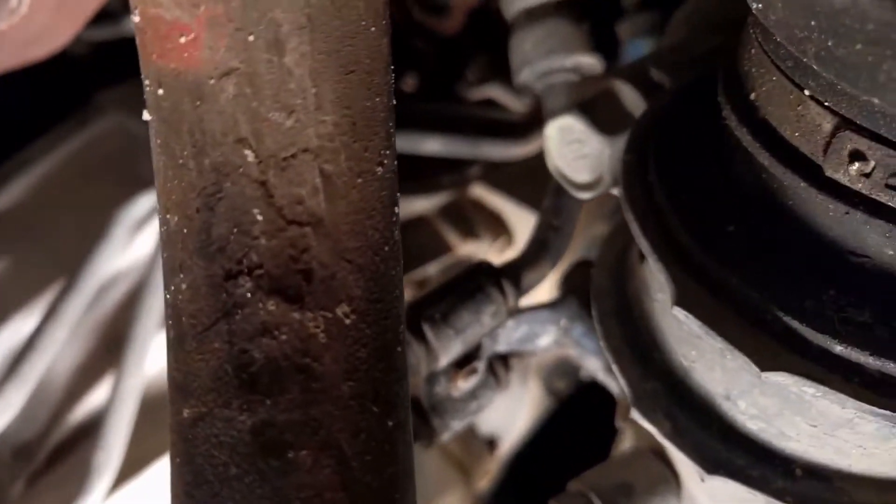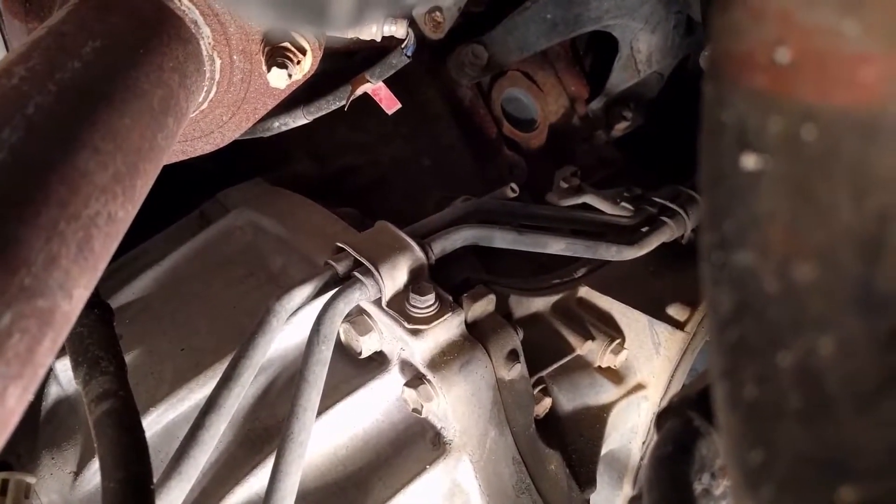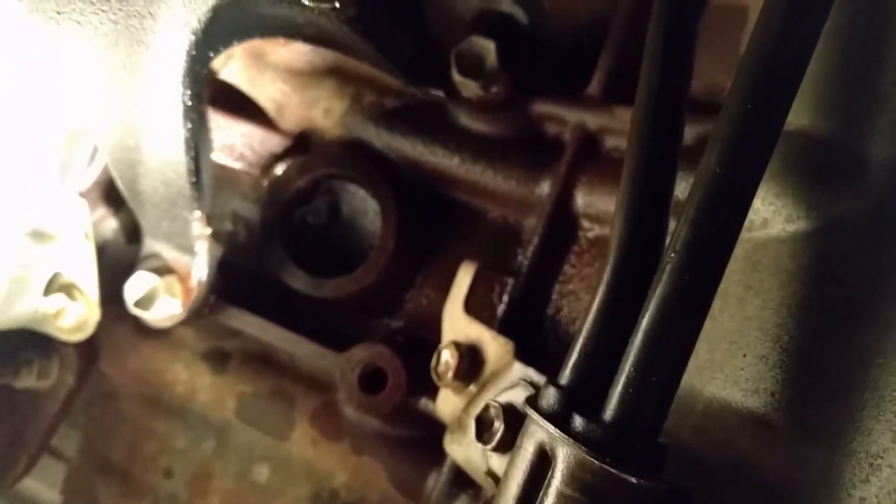To bust that out, you're going to use a chisel and hammer. Obviously, get some catch pan if you want to save your coolant and reuse it. So here's another angle looking up. As you can see, the frost plug has been chiseled. You can tell I've been kind of tweaking on part of it there — it's not perfectly round anymore. So basically you're just going to have to find a way to get it out of there. It's a softer metal than the steel, so don't be afraid to distort it. Some people will probably use pliers. I'm probably just going to try to get it out with this chisel and hammer.